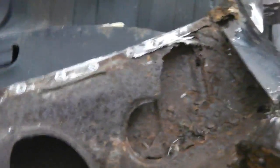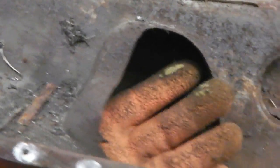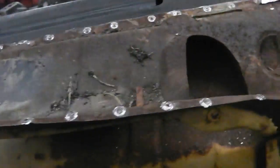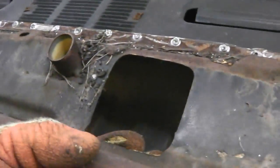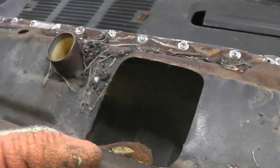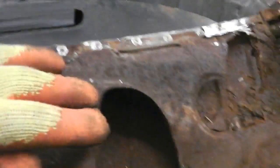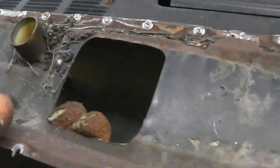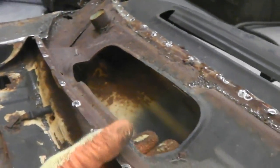This though, as more than a water trap, I'd say that's your air intake, because if you think about it, look here where my hand is. I haven't got a heater to show you, but the heater box of the Cortina fits there. Your blower motor's just here in the bay with the heater box, and the air intake's right behind that, which is right in line with that. So I think it's drawing the majority of its air through this. These, I think, are for the wiper motor links. I don't think that's to let air in, or it could be to keep an even distribution. That could overload, so it spread the loading of air. But maybe it just draws from those two points. I'm sure that's to get clearance on the wiper linkages.